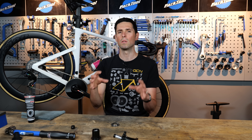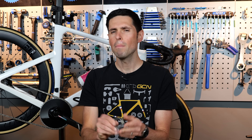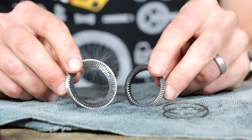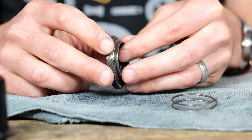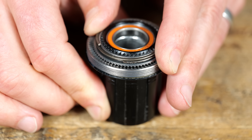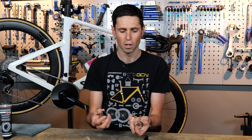This is a design which has been used for a very, very long time, but like all things, there's often ways to improve. Along came the ratchet freehub, designed and invented in the 90s and protected under patent for a very long time. The way in which a ratchet freehub works is you have two metal rings with opposing metal faces. One side is connected to the hub body, the other side is connected to the freehub body, the part where your cassette is connected to.